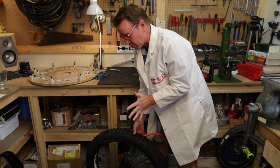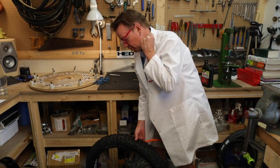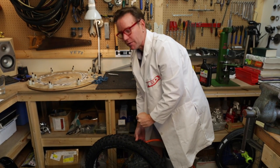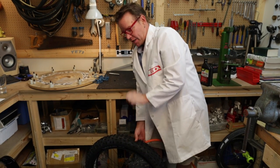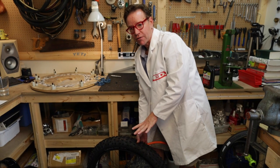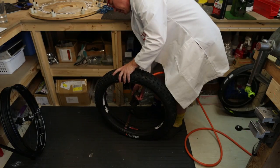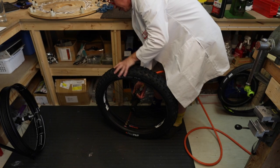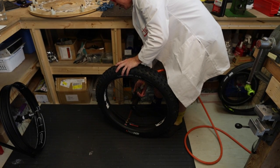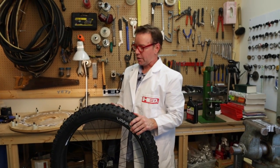I'm not getting any action. There are a couple things you can try. The first thing would be just to whack this tire — really squawk it — and that might just shock it up so you get a seal for a second. All you need is a second of seal and then your air is going to take over and blow this thing up onto the rim. Squawk, squawk, squawk — I'm up! Did you hear the snap? That was the bead going up onto the rim.